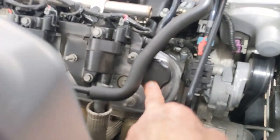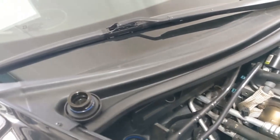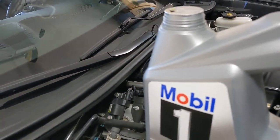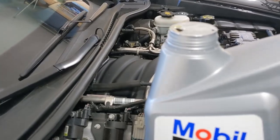Don't put the oil in there. This is a dry sump system that's got a reservoir up here — the oil goes in there. This is a dipstick. Once you fill it, this calls for 10 and a half quarts with the oil filter included. It's a little bit slow, and I'm still going to get a funnel.